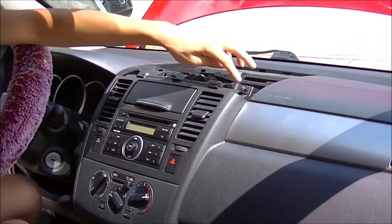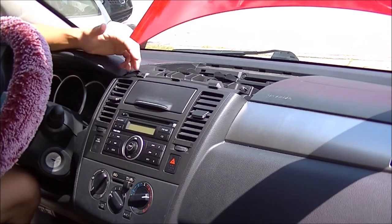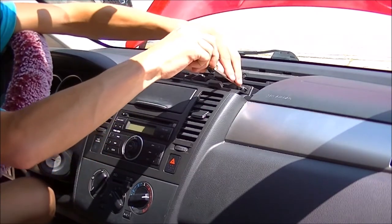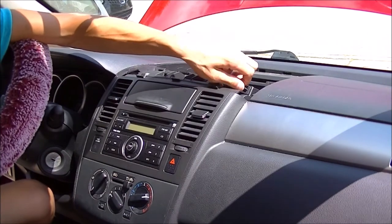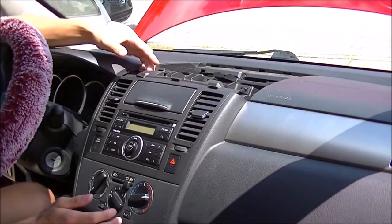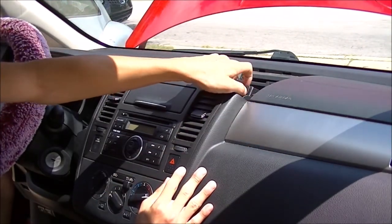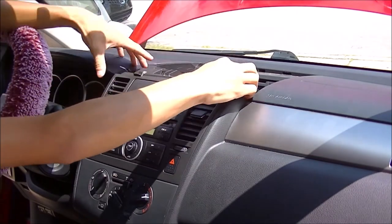Using a Phillips head screwdriver, there are two Phillips screws on each side at the top of the radio fascia — the piece of plastic in front. We're going to remove those. Then we'll use the nylon tool to add a little leverage and carefully pop the plastic clips off one at a time. You shouldn't have to pry hard at all — it'll just come out.